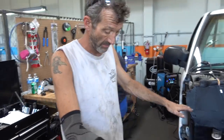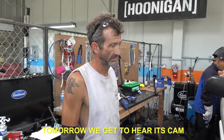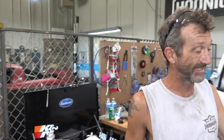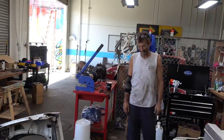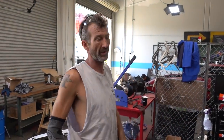Today we'll probably be able to get this thing back on the ground, get the spindles on and set the pinion. Tomorrow will be electrical, fuel lines, oil lines, and maybe a fire up. You can hear the cam — you can hear that big wild motor. He's determined to think that I actually built this motor. I can guarantee this is a GM sealed, factory sealed motor. If we wad it up, you guys will see all the factory parts all over the back. That is a factory sealed GM motor — that's how confident I am. Drive shaft's tomorrow, and our alternator back tomorrow. What we did is we had the alternator sent out so that we can only run one wire — we don't have to run the excited wire. It just runs a big power wire — when it moves, it works. That way it simplifies the wiring.